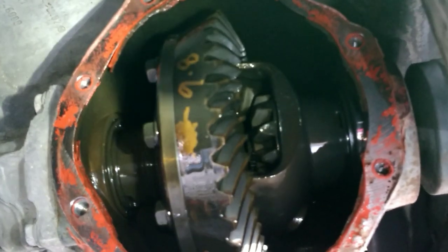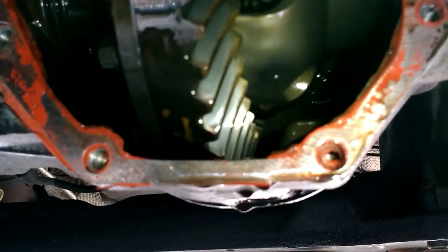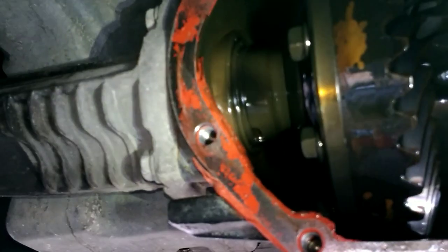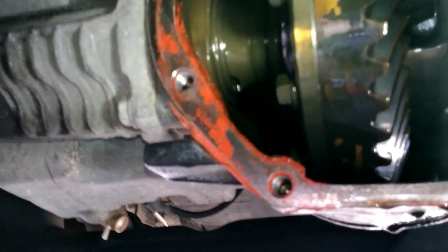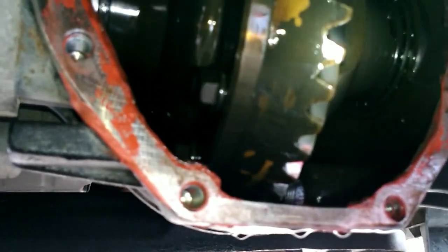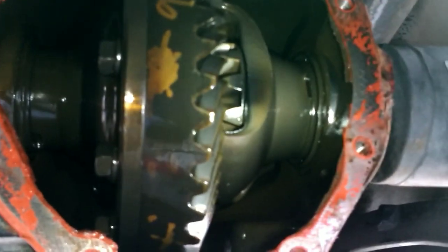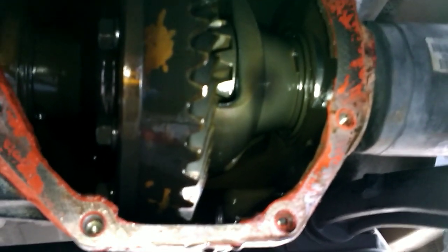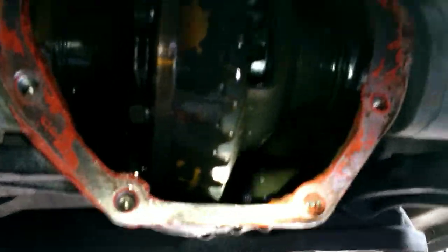It's got a 9.8 mark on the ring gear. You can kind of see the pinion in the back there. Apparently changing those bearings is quite hard to do, but while I'm in here I might as well let you take a look. It seems kind of dirty in the differential. I changed the fluid on it once when I got the vehicle at 200,000 kilometers.